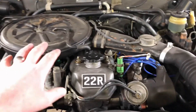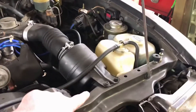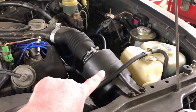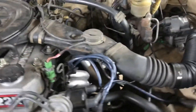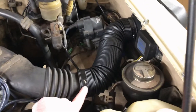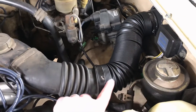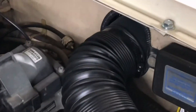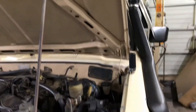This is a foam pre-cleaner with a zip tie on it — just a little foam pre-cleaner to catch dirt and pine needles. So how did I make it work with the intake? Let's go over the stock 22R carburetor. You've got the air filter, crossover pipe, and factory box that goes in the front. Take that box and throw it in the trash. Take this tube, flip it 180 degrees. I took that crossover piece and basically turned it 180 degrees — just flopped it. Then this is just some cheap air duct flex tube from AutoZone, about $10. Hose clamp, bend, right there to the snorkel. That's it. It completely bolts right up. No air restriction, nothing.